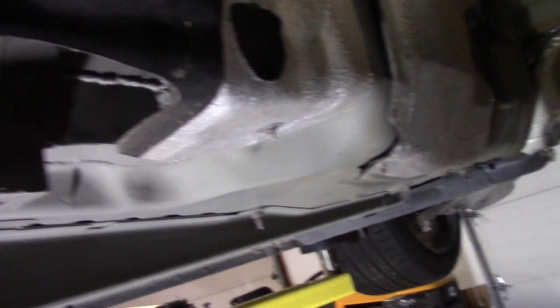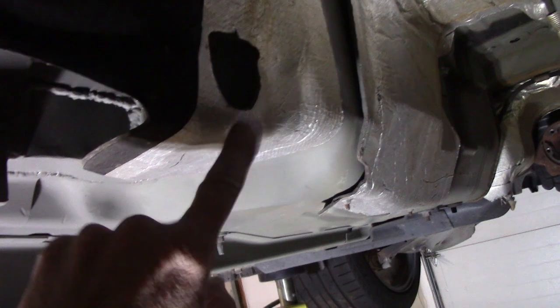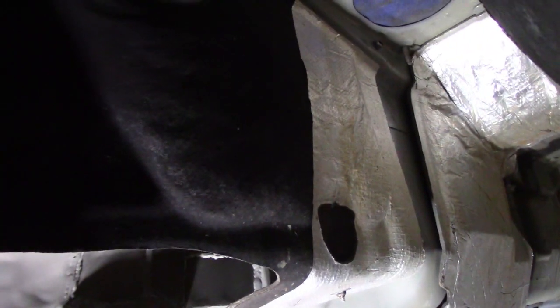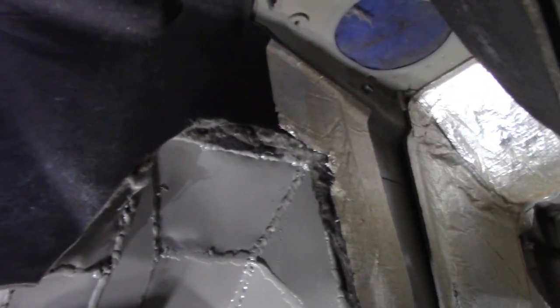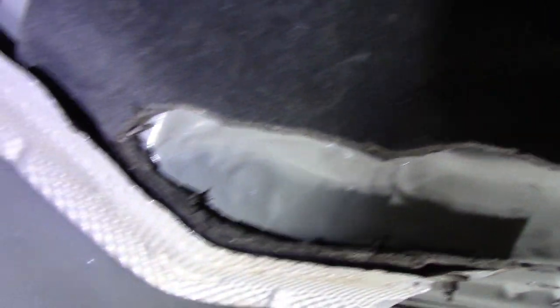Now that I have the steel of the body modified, I bolted on this heat shield and sound insulation. I'm trying to figure out where I can cut it back to keep as much of it as possible, yet obviously have clearance for the drive shaft and the transfer case. So I'm just going to start marking it with a marker and cutting it away. That doesn't look too bad — clearance for the future drive shaft spot and for the transfer case.